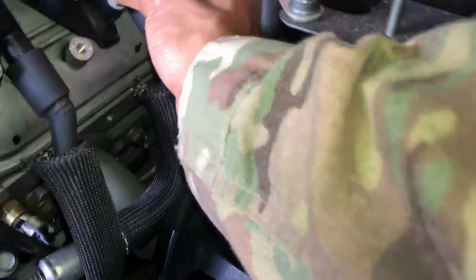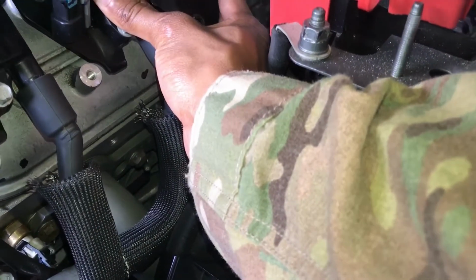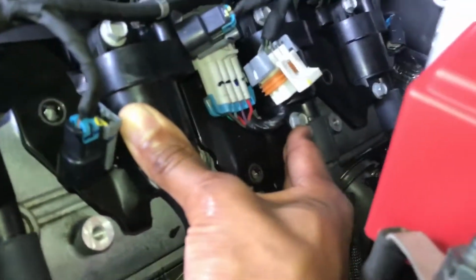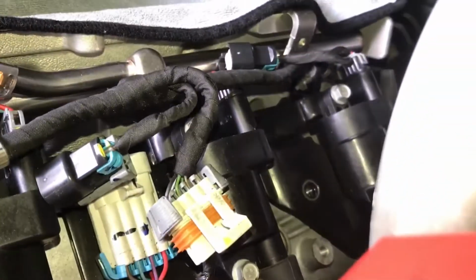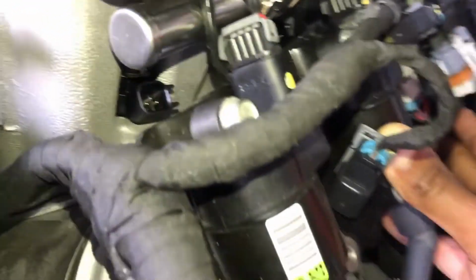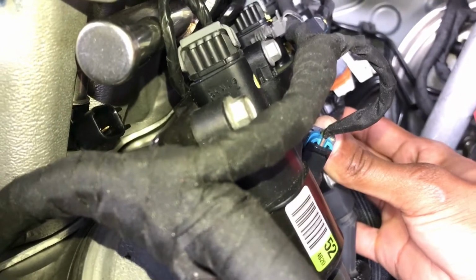And so remember, I was telling you guys about having to change either this valve cover or having to try to figure some way to lower the coil pack bracket. This is what I was talking about. You see how close this is contact wise, and of course you see this plug here. This is where the injector would sit, for the plug for the injector, and it just isn't quite enough room.